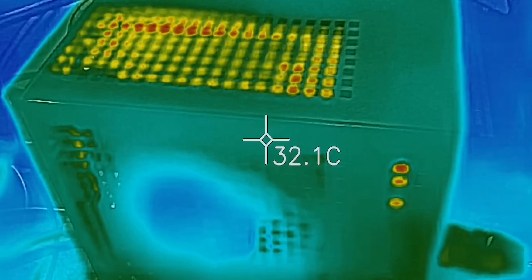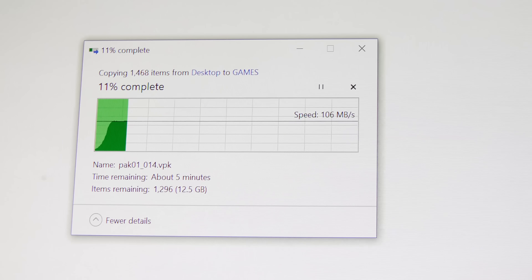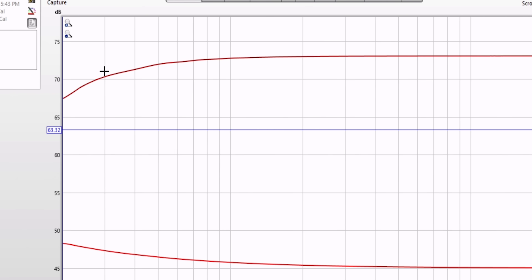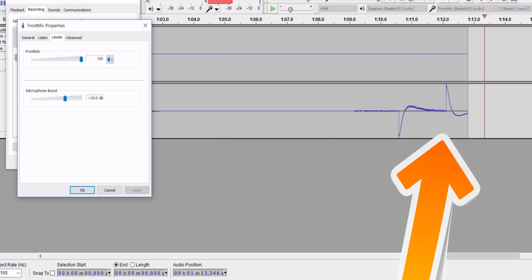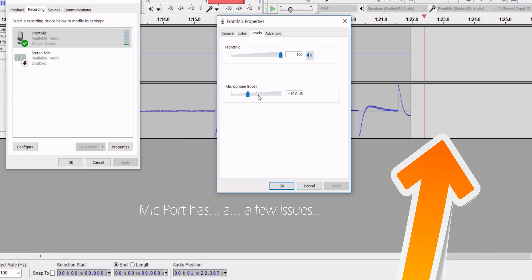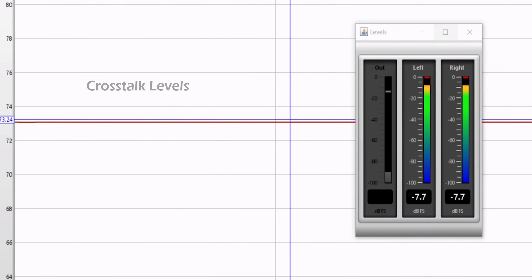I was very impressed with this unit's ability to ventilate heat. USB 3 speed transfers on my Kingston SSD drive were showing over 300 megabytes per second - absolutely fine. Internet speeds on the Realtek were getting over 100 megabytes per second copy transfers. The last tests were the onboard audio. The audio out is decent - below 10 hertz we only got an 8 dB roll-off, and after that it was a pretty smooth line. However, the mic-in port was showing some serious issues with 30 dB inconsistencies and volume jumping around, so don't use the mic-in port for any serious audio recording.